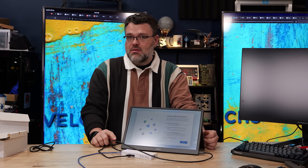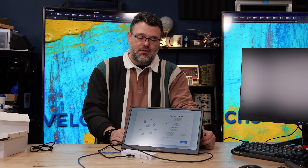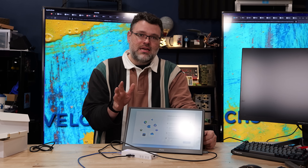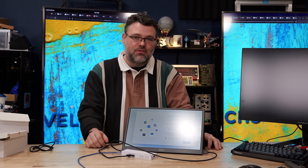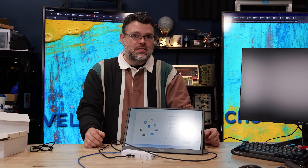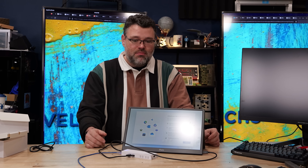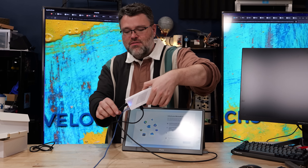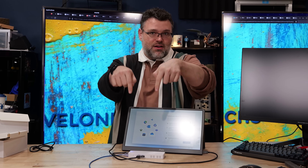Our N100 in here has a peak power draw of 15 watts, plus whatever you've got for peripherals. Our screen — this is a 15-inch laptop screen from Pixio — can be on the order of about 8 to 9 watts, still under a 35-watt power envelope for four efficiency cores of the Alder Lake generation. We've got 256 gigabytes of storage and 8 gigabytes of RAM, all running off of a single 2.5 gig ethernet cable.